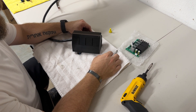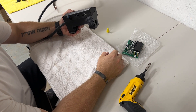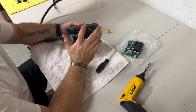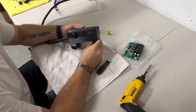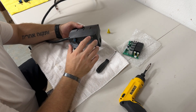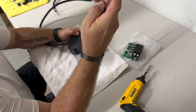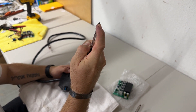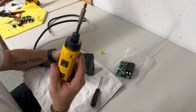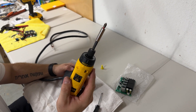This video shows how to replace the circuit control board on the integrated speed controller boxes. It works with both the straight bar box and the Y bar box — the method is pretty much identical, so use this video regardless of which controller you have. All you'll need is a Phillips one screwdriver, which has a sharper point important for the small screws on the circuit board, and a Phillips two, which is the most common Phillips.